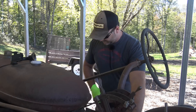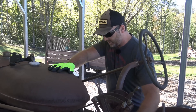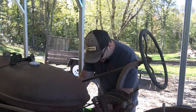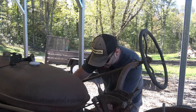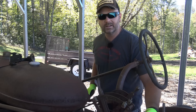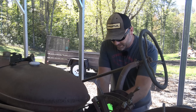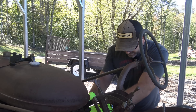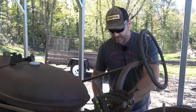It's still got a little charge on it. Let's make sure we're in neutral — yep, we're in neutral. It's still got some charge, but not much. You hear that? I kind of think we've got an issue with the magneto. I think the magneto needs to be re-magnetized on this. So we'll let Mr. Glenn, who purchased it, tinker with it and have some fun. We're going to go ahead and disconnect our positive and negative battery terminals. They're not on very tight, so that's good.